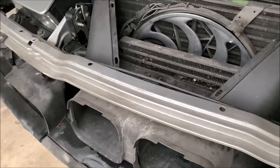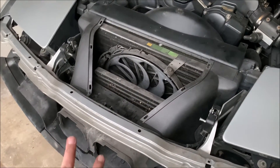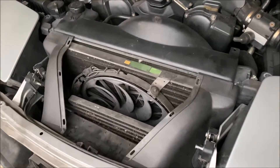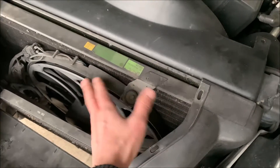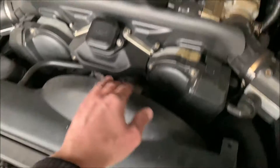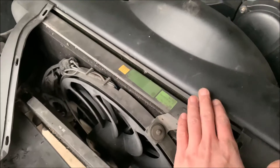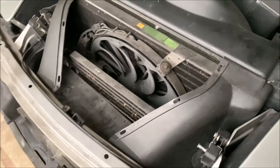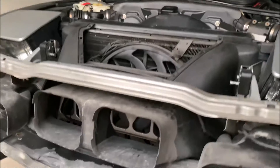You can see how nicely this is packaged and built. We have the two nostrils, we have the air ducting to the radiator package, we have the radiator for the servo oil here, one electric fan here, another visco fan here, and we have the condenser and the water radiator. Everything is beautifully sealed and we have the massive air intake underneath.